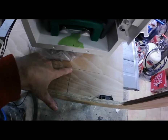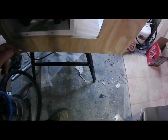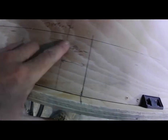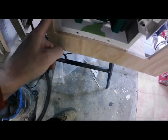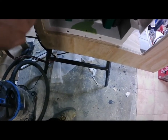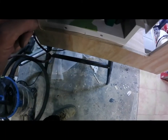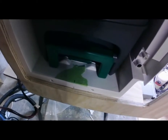This was the center line, like a wheel arch, etc. You know, these plastics, and we can move the inspection door to right. And you see, I measure it. It's 42 mil. And still, to tell the truth, if we make some mistake, we have still some space here. It's not big space, because here will be like an inner frame of the door, but still we have something like a 3 mil reserve.